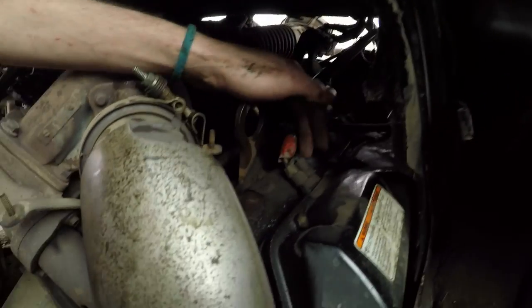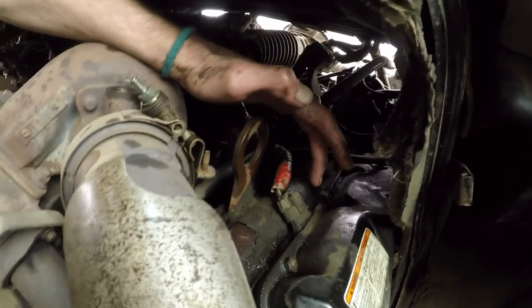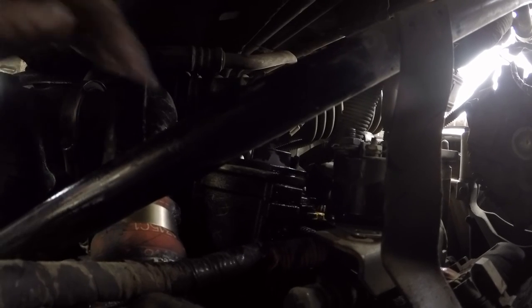We're going to have to reprime this fuel bowl again, I believe. We know I got it to fire, so we don't have any major mechanical problems. I was worried about possible glow plug driver issues, injector problems, and wiring harnesses — these are prone to failure in the 7.3s like mad. Cam position sensors are known to fail like crazy. Let me crack the fuel cock on the front and see if we can hear any fuel come out.